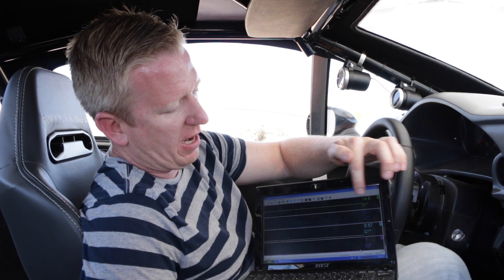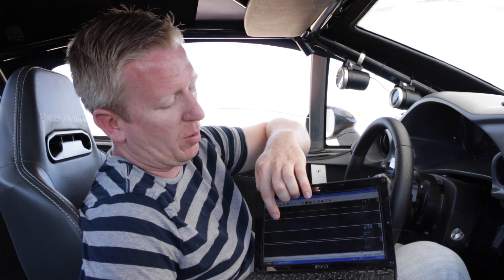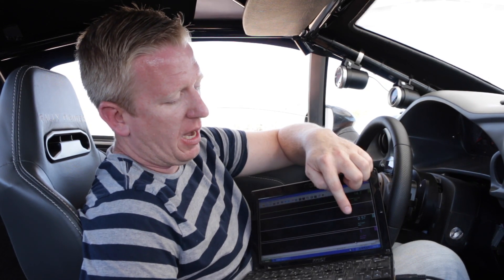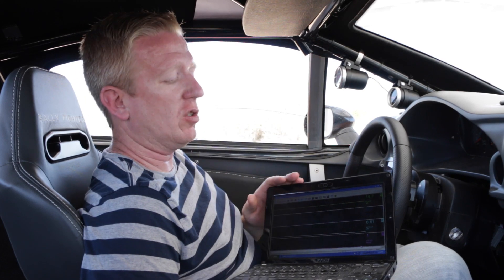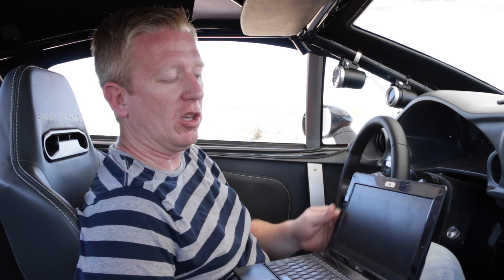What you can see here is we've got our actual air fuel ratio, our RPM value, and where we're at at that particular moment in time. We have a user adjustable value here which we're actually using for our manifold pressure, since we do have a boosted motor, and we're also using our throttle position. There are a few other sensors we can add, but for the time being we want to measure these for our tuning purposes and we'll look at adding other features to this system later.